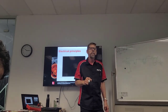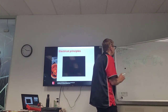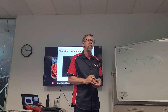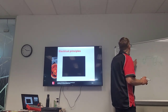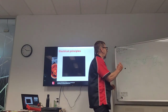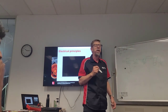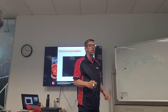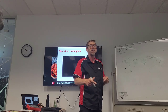So I think the multimeter was placed only in three places, not in the fuse. Oh, well, okay. It doesn't matter anyhow, we'd have done the same thing, but yeah, it'll be zero all the time. So now if it's closed, the fuse place will also be 12? Sorry? If you measure the fuse? Yes, because there's no difference on this circuit now. This circuit, up until the resistance, has 12 volts all the way through. But as soon as it goes through a load or a resistance, there's a voltage drop at the other end because the resistance in that load has caused the energy to be used and becomes back to the ground as a zero voltage.